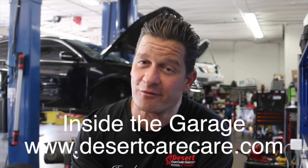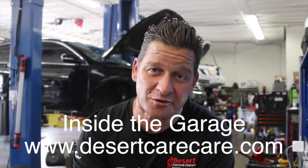We did identify the leak — it's the bypass tubes. Very common, they're plastic. We're actually going to replace them with bypass tubes that are metal — this is an updated design so we don't see this car back in the shop. I'm Frank, thank you guys for hanging out with us. Share this with the world and your friends. If you like the videos, give us a thumbs up. If you've got any comments or feel like you've got a car need, get it down in the comments and we'll video the best we can right here from Inside the Garage.